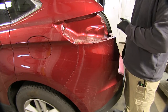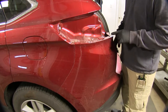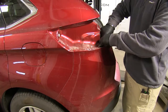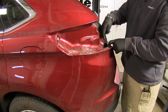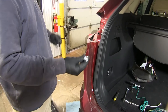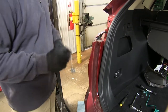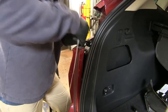Repeat the same process for removing your taillight on the passenger side. Now we're going to run our wire up right behind our fascia — it's kind of tight and we won't be able to get it through that hole. There are two fasteners here; pull those out to give enough room to get the wiring up from underneath. You can use airline tube, a wire hanger, a nut, a bolt, or even a closed-end wrench — tie a string on one end to weight it. Pry this out a little bit and drop it down until it comes out the bottom.